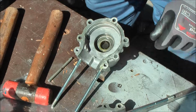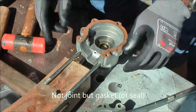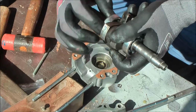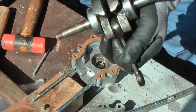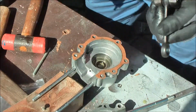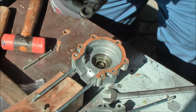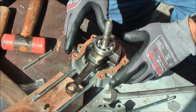The carter halves are preheated now, so I will put the joint first, to promote that it slips in as light as possible. It's ice cold. Okay. Put that over here. I measured this space, 6.6 millimeters, and I have found a wrench that is 6.6 millimeters also, and you will see why I did that. So this is the circlip side, this is the clutch side. I slip it in right here, and it slips in by the cold and the heat of these carter halves.